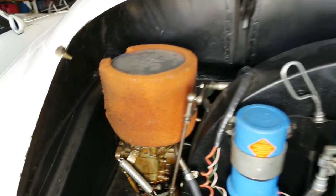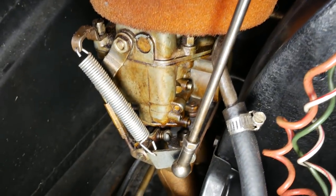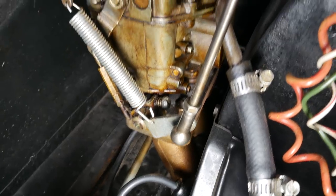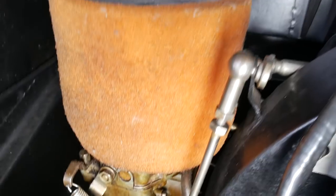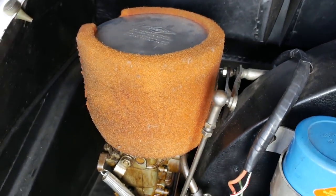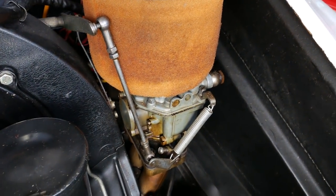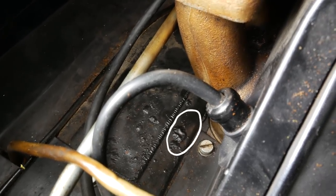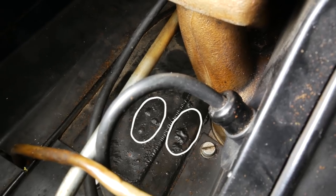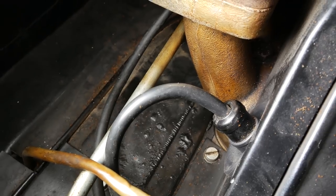To give you an idea of what we're looking at here, this is the left carburetor and you can see it's kind of schmutzy in there. There's a lot of dried gas — it's brown and it shouldn't be; it should be sort of silvery colored. These air cleaner elements on here are absolutely falling apart, so we're going to replace those. The other carburetor on the right side doesn't look quite as bad, but we'll pull it and clean it as well. Do you see all the little bubbles in the paint of the tin work down there? That's from gasoline — a telltale sign that our carburetor has been dripping.